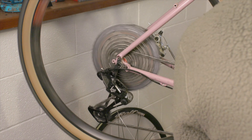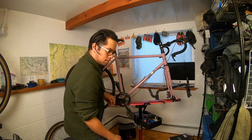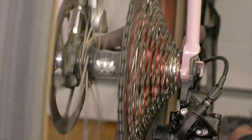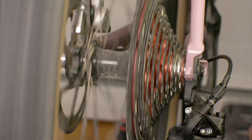Before we check this out, I want to do a little bit of myth busting. I've gotten quite a few comments from people saying they can shift an NX Eagle rear derailleur using the Rival 22 brifter. On paper, this shouldn't work because the road brifter uses exact actuation and the NX Eagle rear derailleur uses X actuation — totally not confusing whatsoever. I didn't think it would work, but people insisted, so I gave it a try. My findings are that it does not work. I could get 10 of the 11 gears, but certainly not the full range.